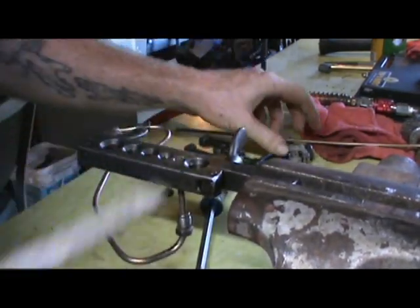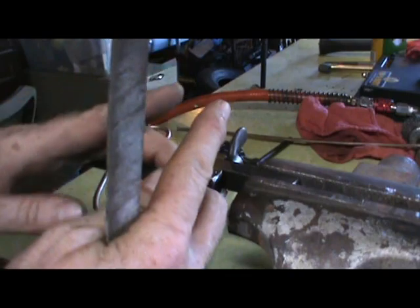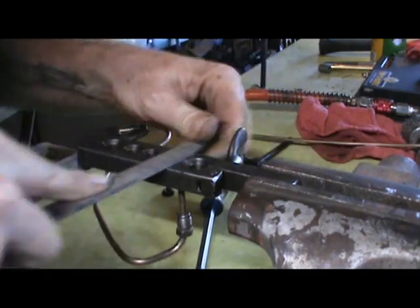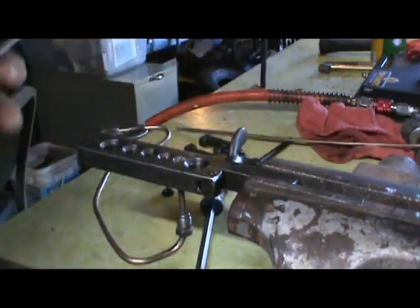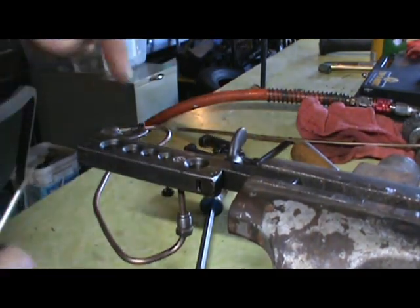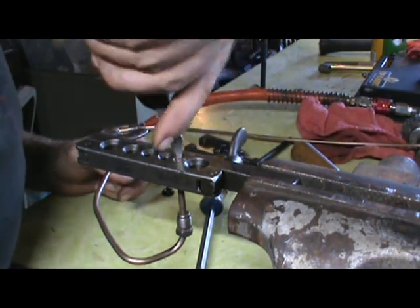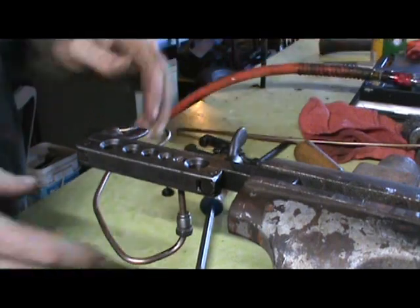This is going to take that little bit of roundness off the top. If you look at this cutting wheel, you can see where that hump is created when you cut. That cutting wheel is shaped like this, which shapes the end of that accordingly. We'll get this cut flat — you can tell when you're done because it loses all the drag. Now, a lot of your tubing cutters will have a little blade you can flip out to cut the inside and remove any burr.